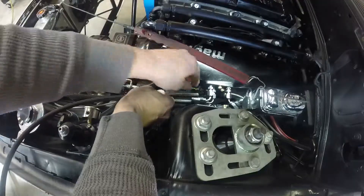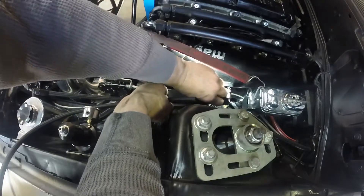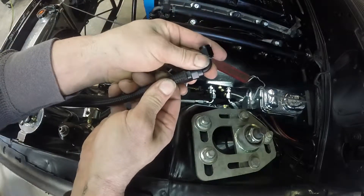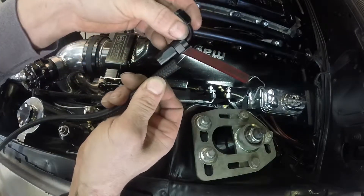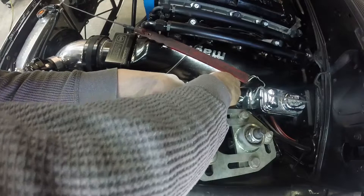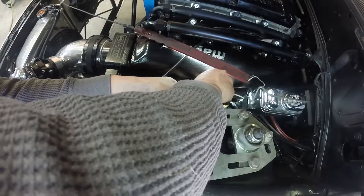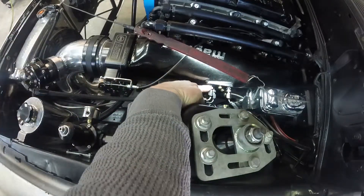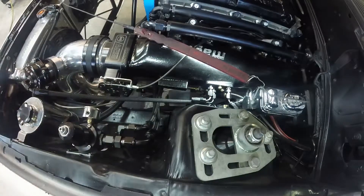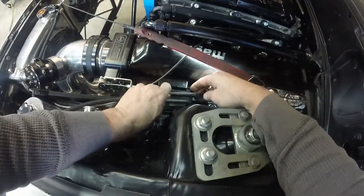I want to mock up my length — figure how far it goes in on a fitting. When it goes into these fittings, it only goes in that far — that's as far as you get. So account for that depth when measuring. When you put these 1/8-inch MPT fittings in, I like to use a little silicone on the threads. This one does have some Teflon already, but I switched over to silicone because I'd rather keep a clean, black engine bay look.